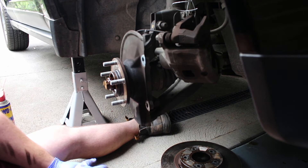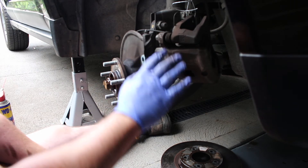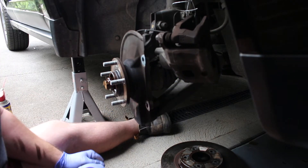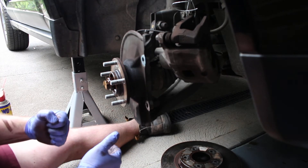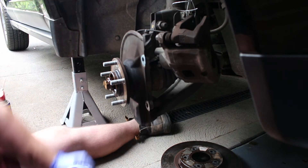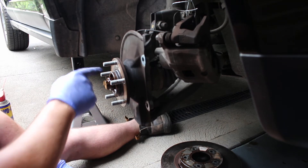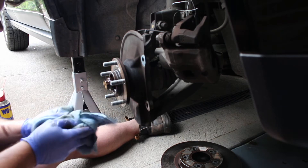So we're going to pop that over there, and we're going to spray our parts cleaner through here. Then we're going to put our rotor on and spray that down as well, just to make sure there's no contaminants on it. Then we're going to put our brakes back on. I'm not changing the pads over this time around because we only changed them recently and they've still got quite a lot of life in them. Later on, we're going to do a decent brake test — get it up to speed and then slam your brakes on like you would when you put in brand new brake pads, and it should smooth them out a bit. If it doesn't, then it's as simple as coming back in here, taking the wheel off, and putting in a new brake pad. So, we'll get our new rotor on. Give this a bit of a clean up first — it's looking like we should be alright. So a bit of brake and parts cleaner right here. Can't have enough of this stuff — it just feels like it melts everything off. Fantastic.